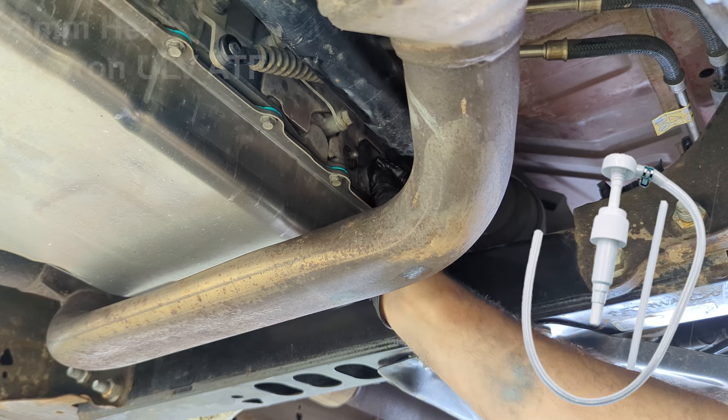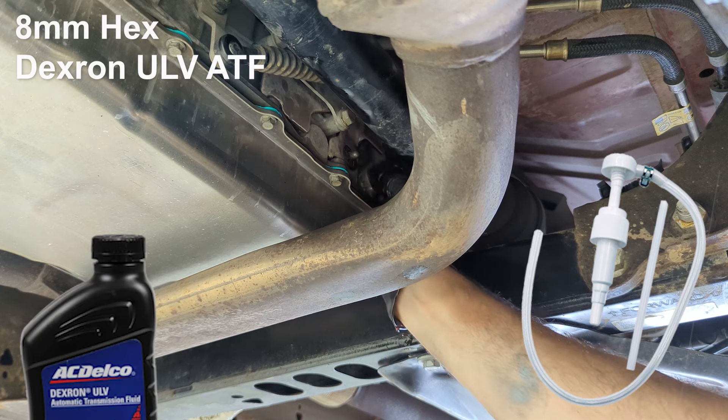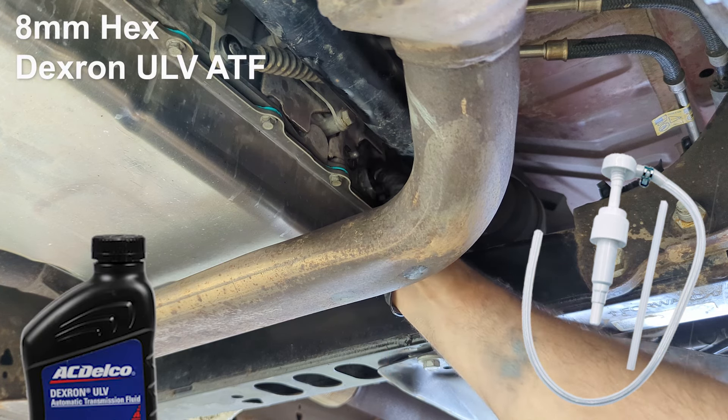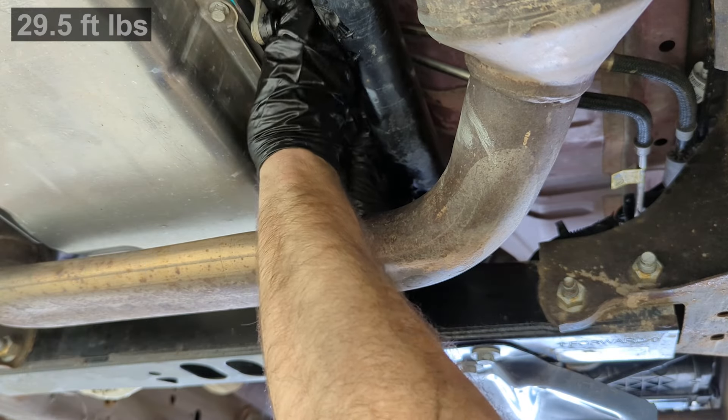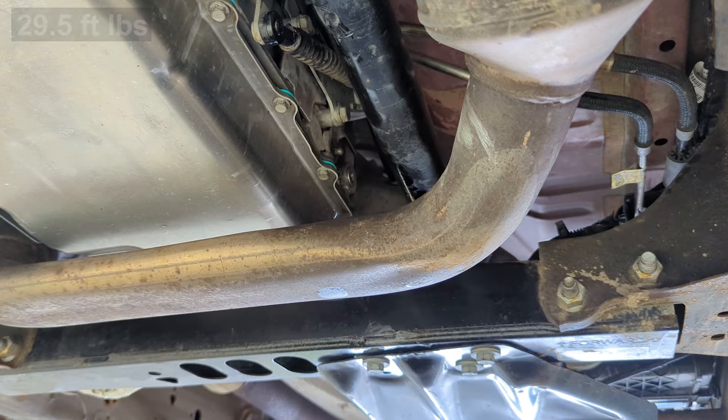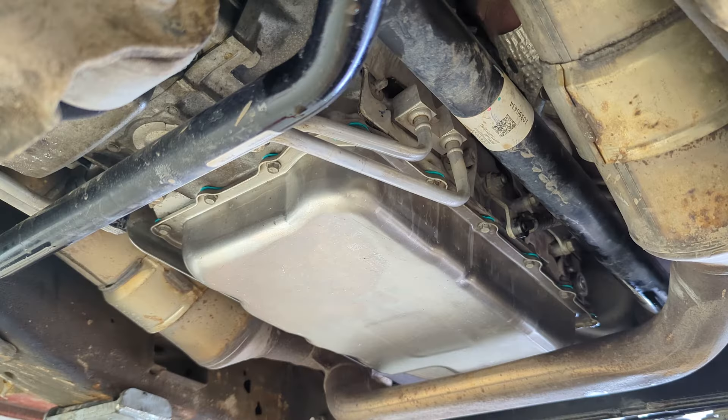You're looking for just a drip out of there — this one is more of a drizzle. It could lose just a little bit more at this temperature to be at the correct range. You add until you get a drip with the vehicle running, or let it run out until all you have is a drip left.